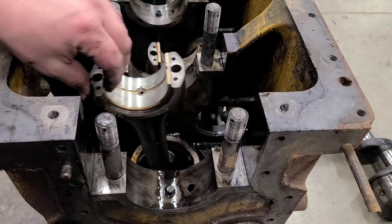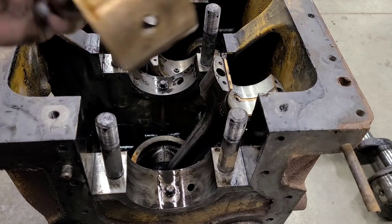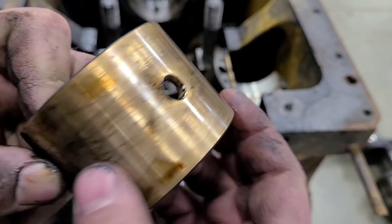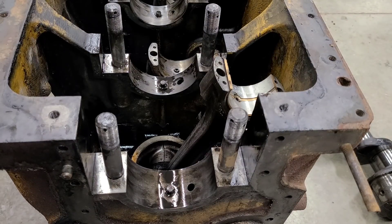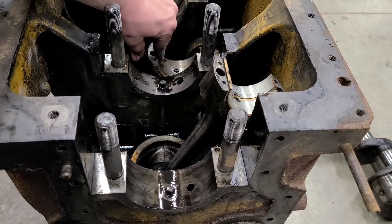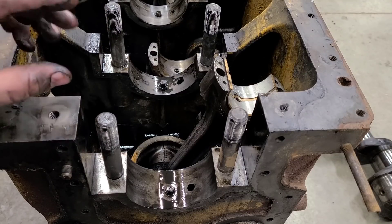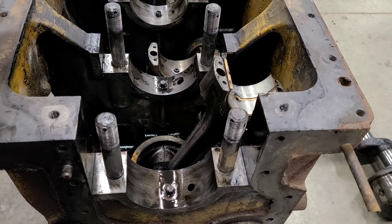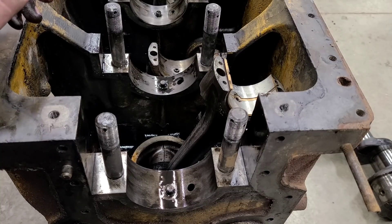I think I'm going to keep working on trying to get the rod bearings out. I noticed that one came out without even putting up a fight. This rod has actually stuck — number two does not move, but three and four move as well. We'll have to see what we want to do for driving the sleeves, pistons, and rods out — either as an assembly, or if we want to try and drive pistons through the sleeves first. It'll kind of depend on, once we get the bearings out, what wants to move and what doesn't — if the sleeve wants to move easier, I'll gladly take the whole works out.